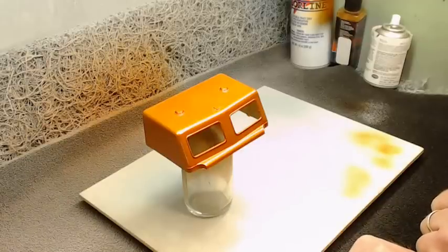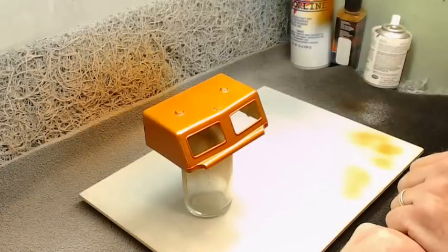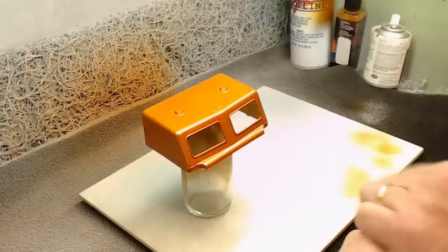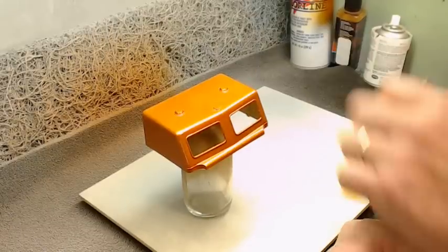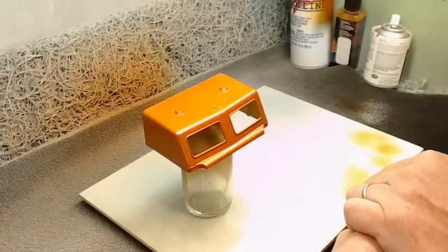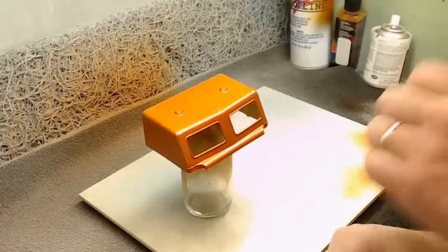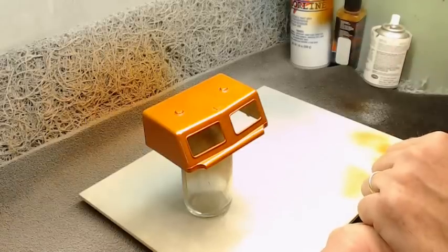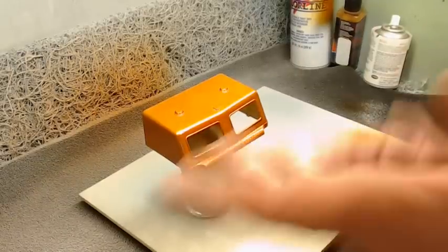You can also spray candy over top of decals. On the heavy commercial truck I'm working on, I have an idea where I'll be using pretty much this color, but it'll be over top of a graphic. There's a lot of different things you can do with candy because they're transparent — anything you put down on that base coat will show up under the candy. On that truck I'll be using a silver base coat on some parts and a gold base coat on others, spraying the same candy orange over both — one will be darker, one lighter, but both will be a true candy color.